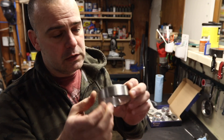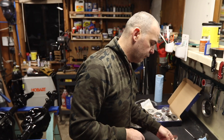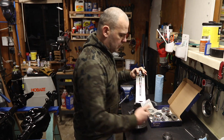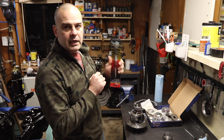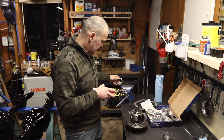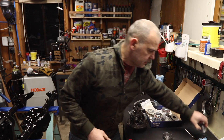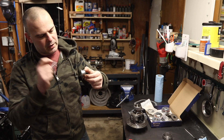This one you make into a setup race by machining the outside. I've read a lot of different ways to do it. For the bearings — not the races — I picked up one of these: a tiny brake cylinder hone. Just like an engine hone, I'm going to chuck this up to the vise and try to hone it out. I have no idea if it's going to work.